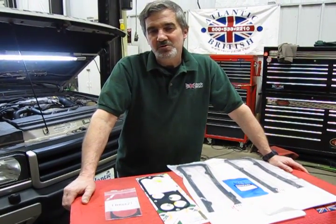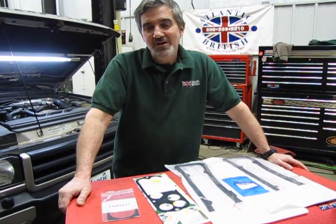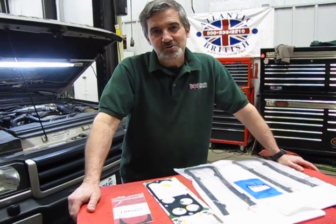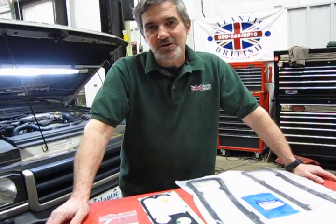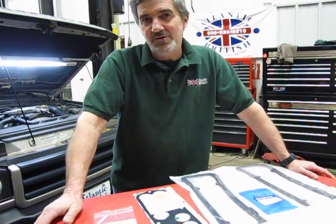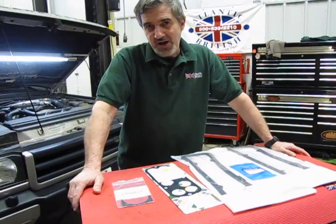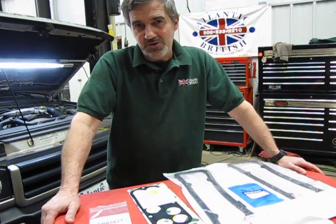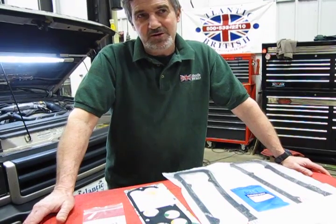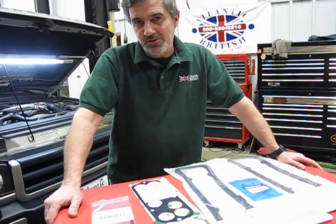And in this video, we're going to show you how to do a regular maintenance item, where we consider regular maintenance, for the 4.0, 4.6, Discovery 2, Range Rover, the Classic, any of the older Land Rovers with the 4.0, 4.6, even the 3.9 and 4.2. What happens is the valve cover gaskets, they're notorious for leaking. You can put brand new ones in there, and next thing, 8 months to a year later, they're leaking again. So you might as well consider them regular maintenance.